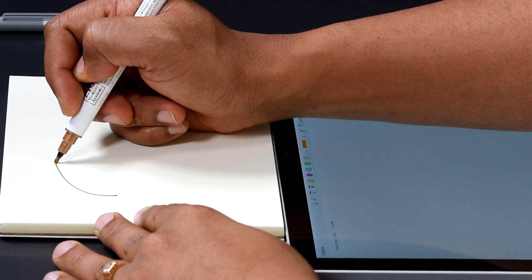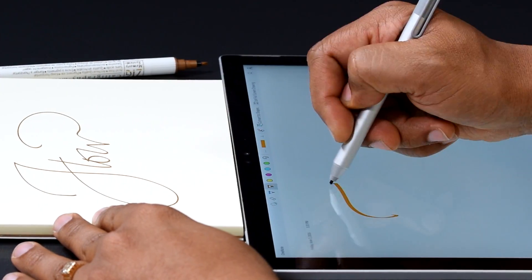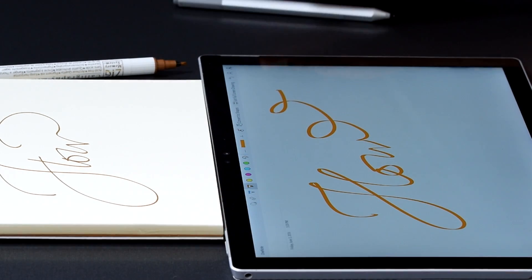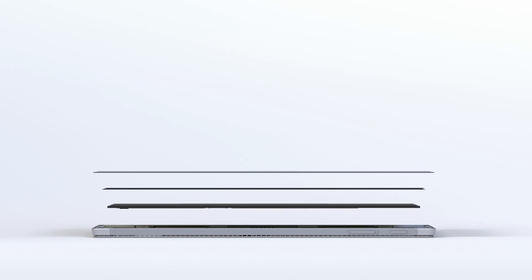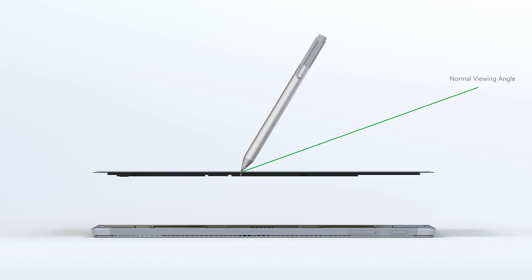When you use pen and paper, the ink flows at the point of contact, and we try to emulate the same experience when you write on the digital screen. But it's an engineering feat to accomplish this. With digital inking, there is a gap — the pen is separated from the ink by an optical stack comprising the outer protective glass, the touch sensor, and the display module. The larger the gap between pen and ink, the greater the potential for parallax error. If you're viewing from directly above the tip, the physical parallax error is zero. But if you're writing at a normal angle, there is physical parallax. By bonding the optical stack together, the gap between the pen tip and ink is reduced to less than a millimeter, minimizing the parallax error regardless of the viewing angle.